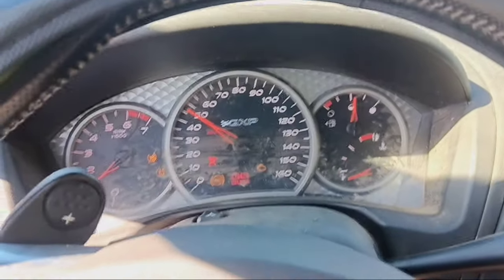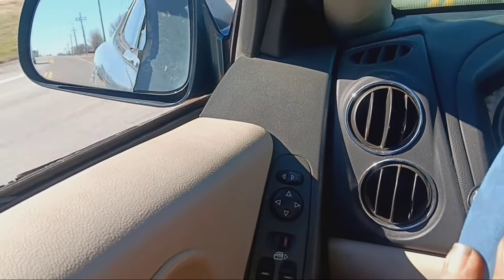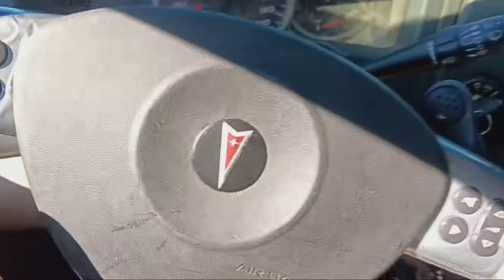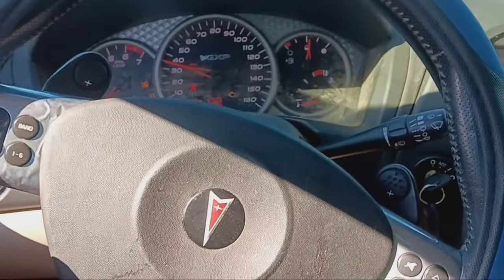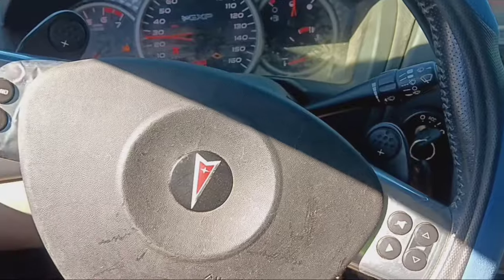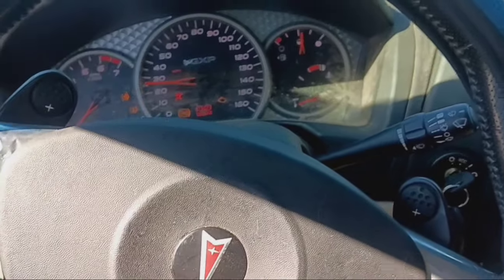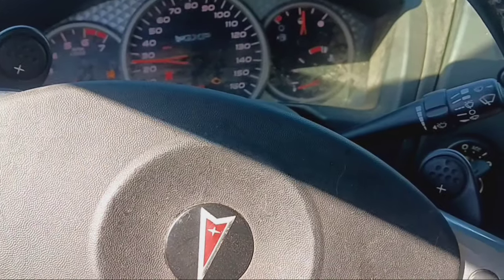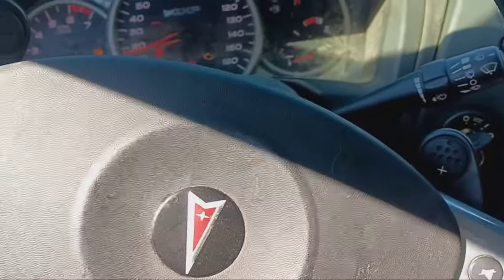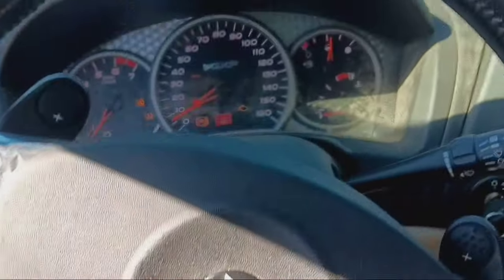I'm on lunch, headed home. You can hear that squealing noise — sounds like a bad wheel bearing. The steering wheel is still crooked, but when I hit the brakes it stops and doesn't turn anymore like it did with the bad control arm bushings. So at least it seems to ride better. It's still going to need some struts, and it needs an alignment and tie rods.